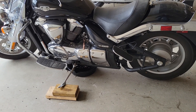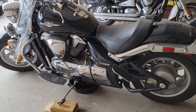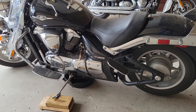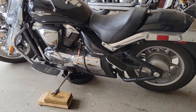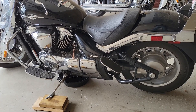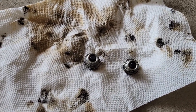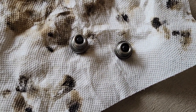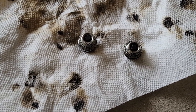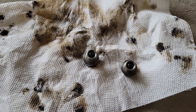We will let them drain, and then I'll stand the bike up straight so more oil can come out. The oil has almost drained. I've used two 2x6 pieces of wood and the bike is almost straight — I can see a little bit more oil dripping out of the drain plugs. Now, these drain plugs — if the oil hasn't been changed for some time, you may have some shavings and metal buildup on them, so be sure you clean those before you put them back in.